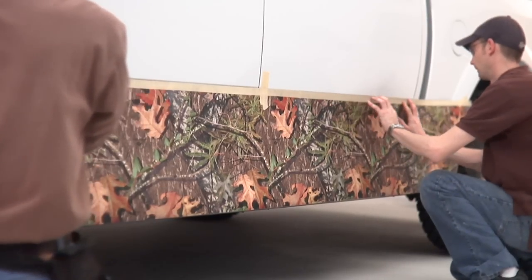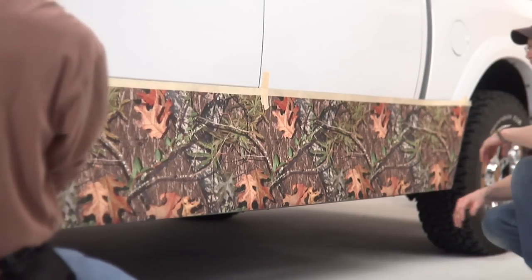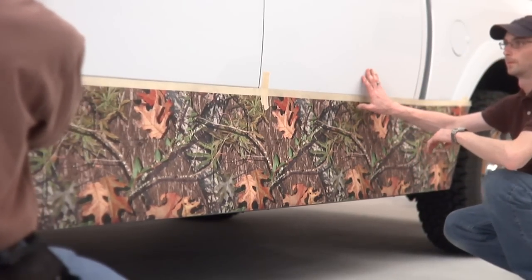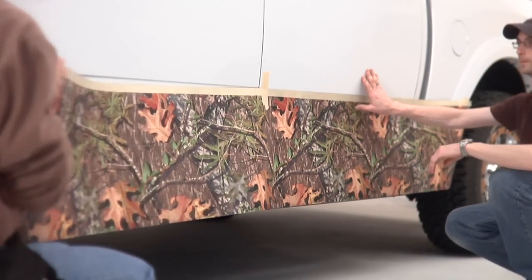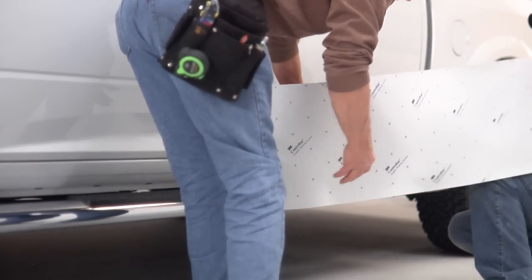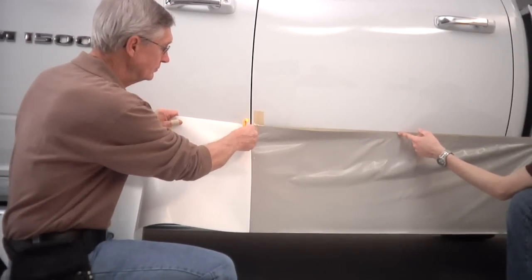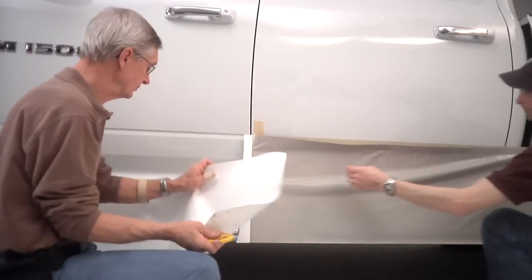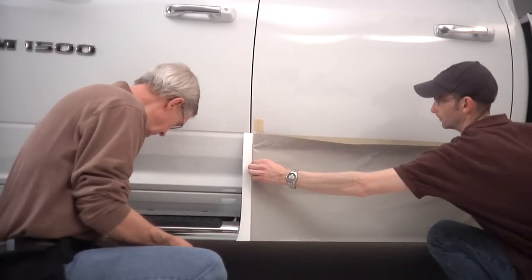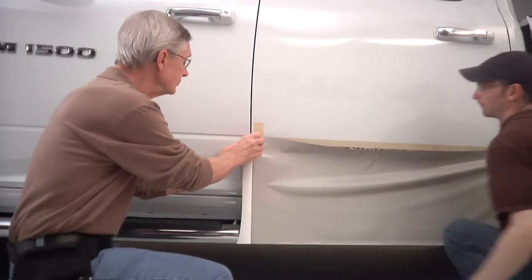Get the masking tape at the front or the rear of the vehicle — it doesn't matter which end you start with — and pull that piece loose. Bring it around and pull the backing off. Once that backing is pulled free, come back and apply your piece onto the truck. Once your hinge is in place and the backing is off, just cut the paper backing loose and you're ready to lay your vinyl down on the side of your truck.